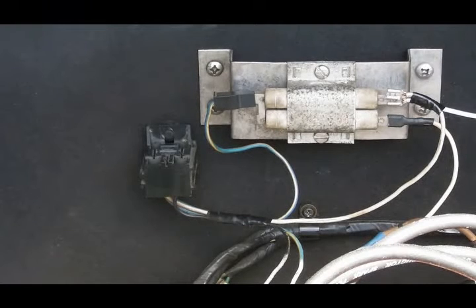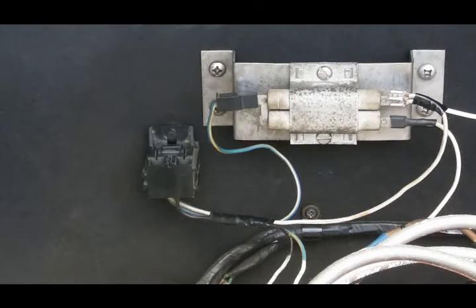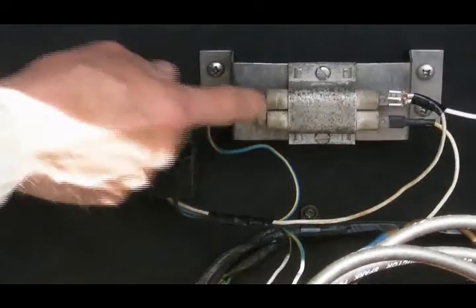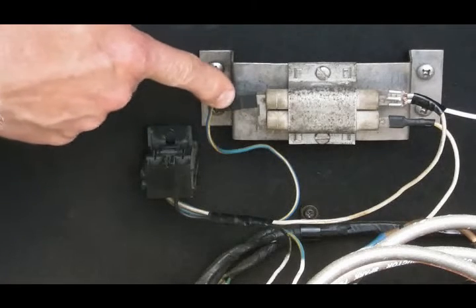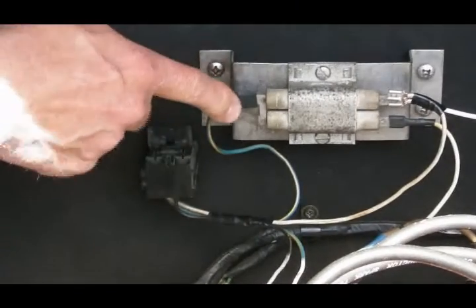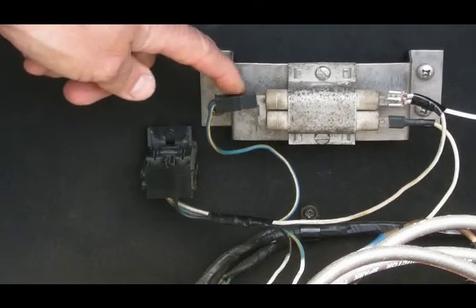He tried to draw a causal connection between the light switch wiring and ignition, which is incorrect. There's absolutely no relationship between the two — they're totally different circuits with no fuses, no wiring, nothing in common. I suspect what happened is that while he was monkeying with the switch right here, he ended up bonking this terminal, which is part of the ignition circuit. That terminal probably was not making good contact, and in the process of banging into it, it started making good contact and his engine started.